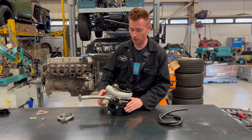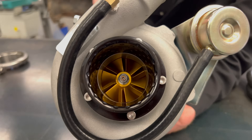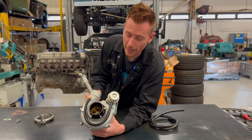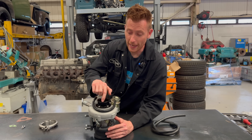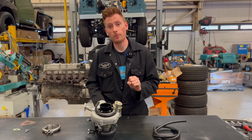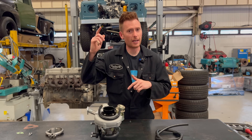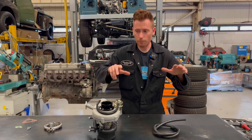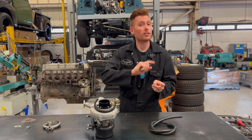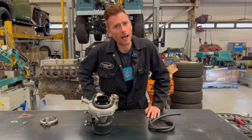To name a few of these awesome features — I think you can probably see one of them without looking too hard. What we've got there is a compressor inlet compatible with all the standard hosing of an E300 or a Land Rover airbox or whatever. But I've integrated the dimpling — the golf ball effect — into the compressor inlet, which means we can benefit from some turbulated air going into the turbocharger. If you want to learn more about that, go to the Motor Trend website — there's an article all about it and it tells you the benefits, all the different places that people have tried the dimpling effect and the two that were proven to be particularly good: turbo inlets and piston crowns. So here it is, ladies and gentlemen, a turbo inlet with that turbulation, which I think is amazing.